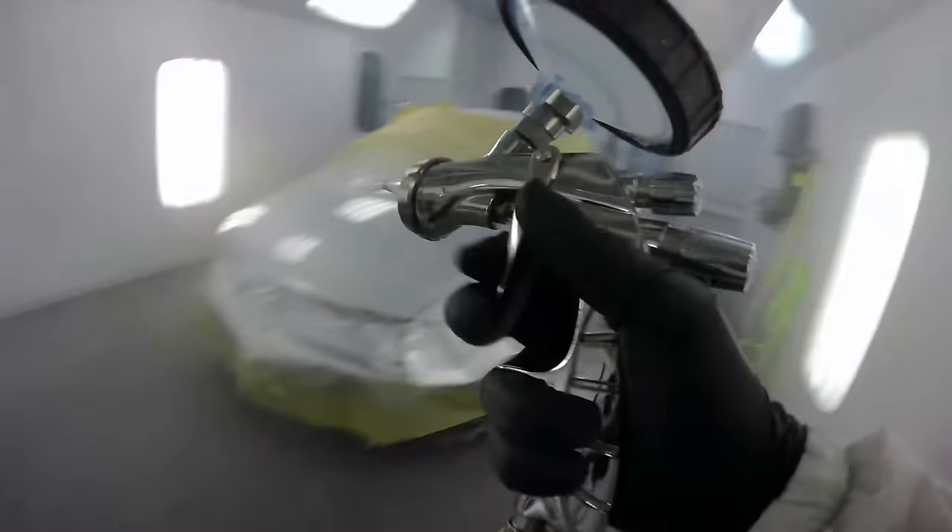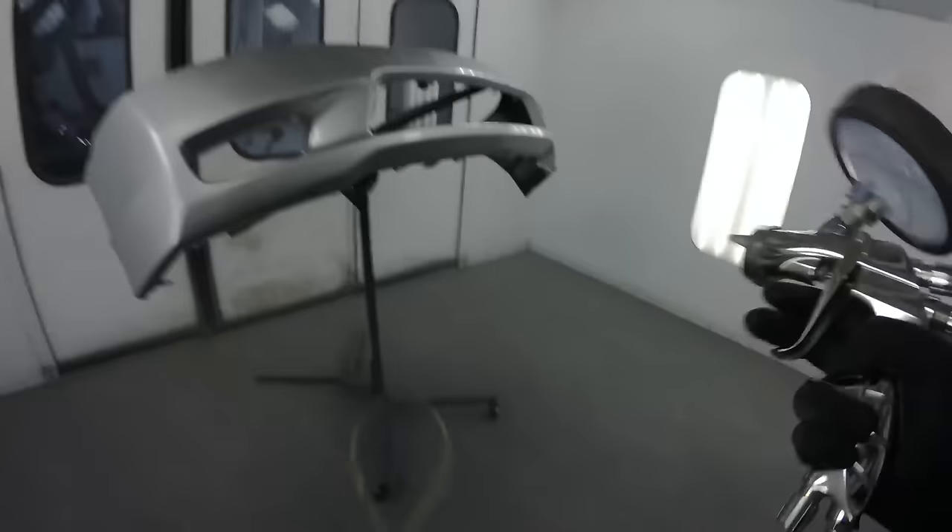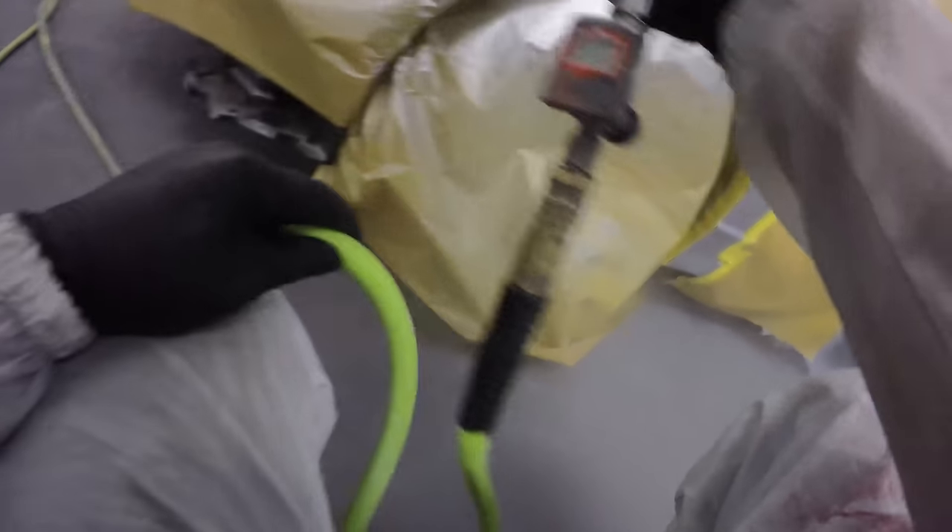You can see that nice bright yellow hose. Inside the booth you want to replace your hoses regularly — not obsessively, but don't go forever without replacing them. What can happen is the insides break away and it'll start shooting debris through your gun, which is a good reason to put on a line filter. Also, change your hoses because they get dirty. Always try to keep the first six feet of the hose off the ground — you'll see throughout this video that I'm constantly wrapping it around something. It makes a big difference in the amount of dirt that ends up in the job.